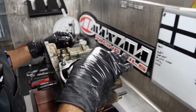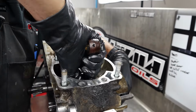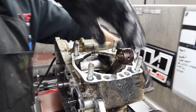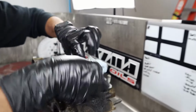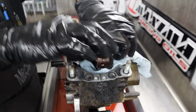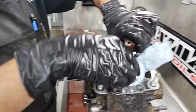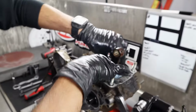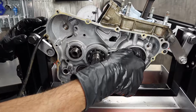The connecting rod feels good. I don't think our squeal was coming from this. You just checking a few things before you pull this case open? Yeah, I was just trying to investigate, locate some play or where that noise was coming from, because it did have a squeal and I did not like it. It could have been clutch related potentially, but checking all our bearing play, our bearings feel good